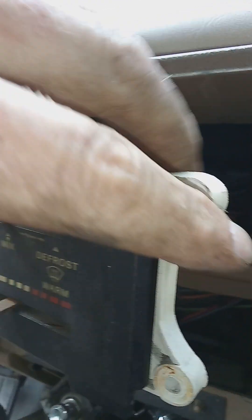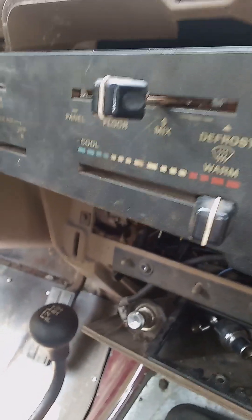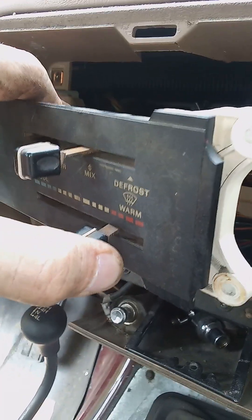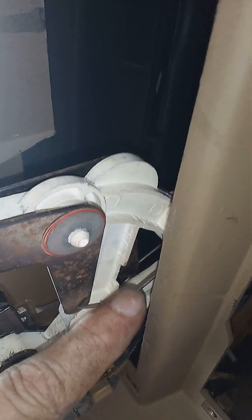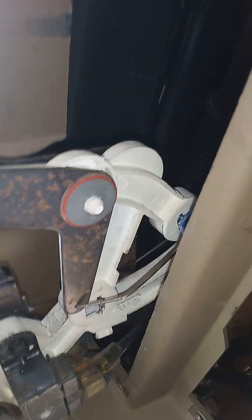The other part of the job — I keep saying blend door but it's actually not a blend door, that's stuck in my head because there is a vacuum-operated blend door here. The problem is right there — the cable's bent, it should be straight. So when I try to move it, you might have been able to follow it — it hung up on the bottom.